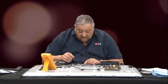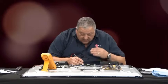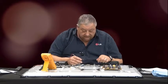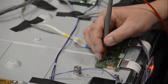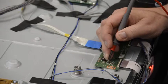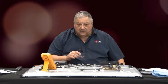The first thing we want to investigate is our VCC voltage. That's made off of a DC-to-DC converter which runs when the 12 volt arrives on the T-Con board. As I measure my VCC, it is unmeasurable — I have zero volts, no active VCC. I look at my VDD — unmeasurable, no voltage. I look at my VGL — unmeasurable also, no voltage. And our VGH — again, no voltage. So we can conclude that there's a problem right here on our T-Con board.